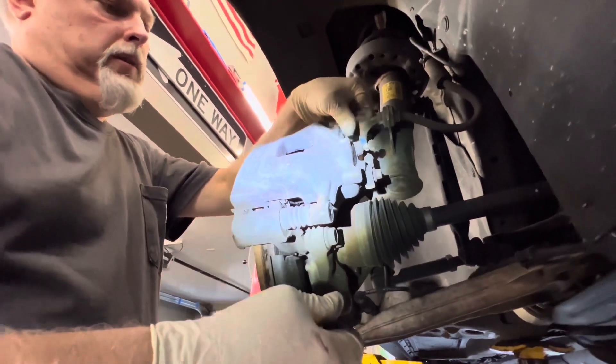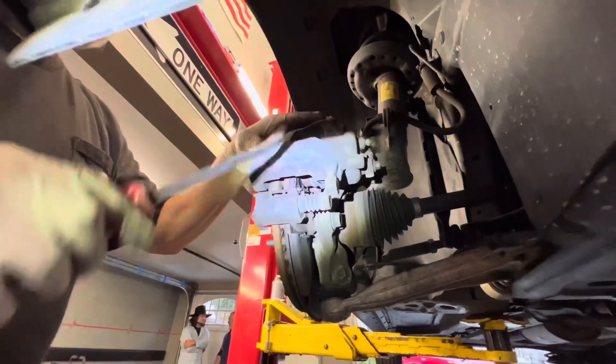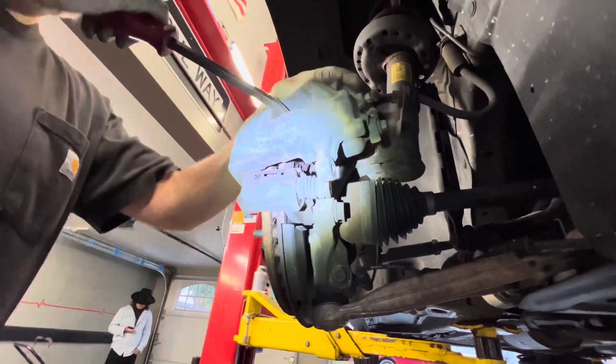It's quick. We've got the two bolts out — the 10. We're going to pry the caliper up a little bit here, try and get in between the brake pads and collapse the piston. You can use the piston collapse tool when you get it off.